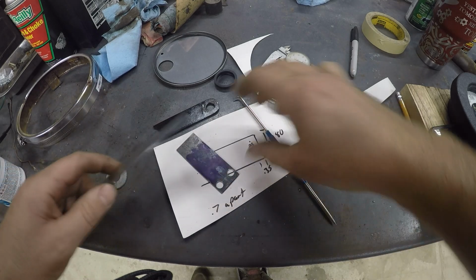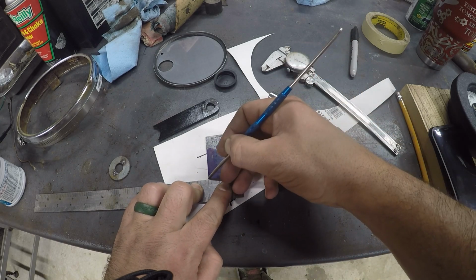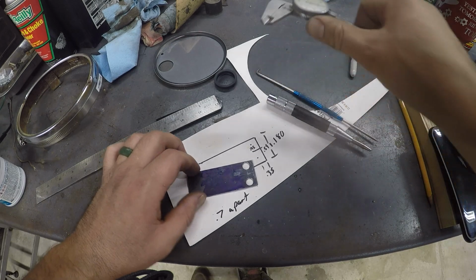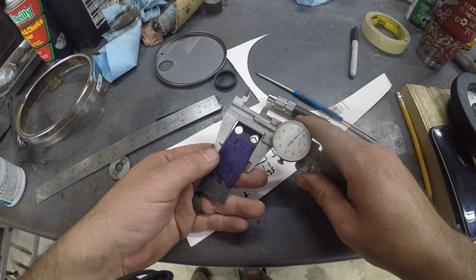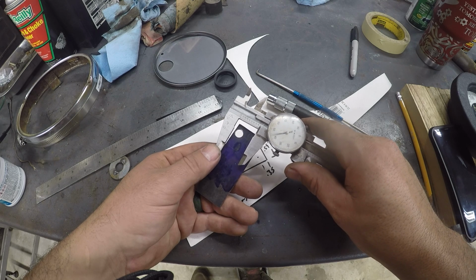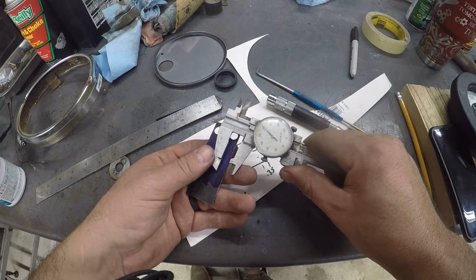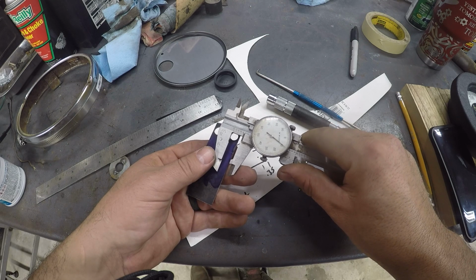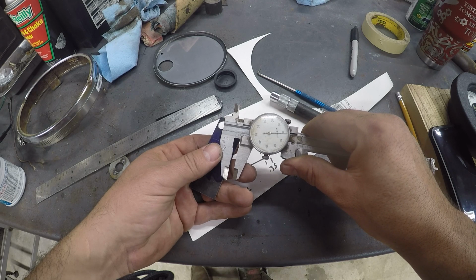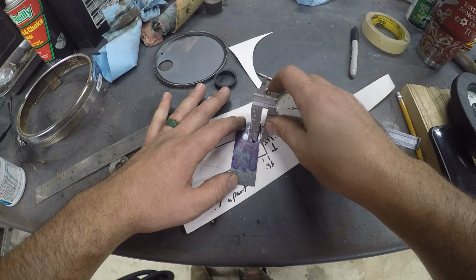So I think what we're gonna do is we'll come out here about an inch. That should give us plenty of clearance. Use our scribe. Scratch the line there. And we need to drop down to 3/4 of an inch here. So what does that give us? 1/8. So that's 1, 2, 3, 4, and 20. So if we go about 410 thousandths. There. No, half of that. Yep. So 200. 200 thou there.